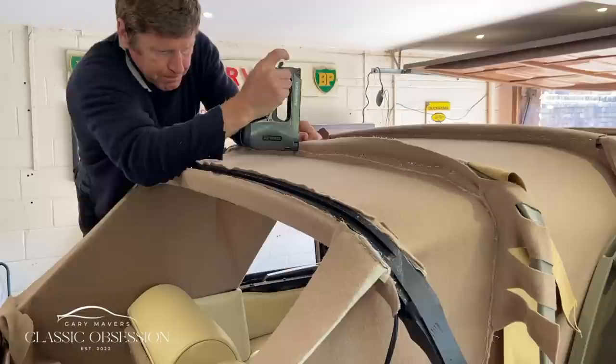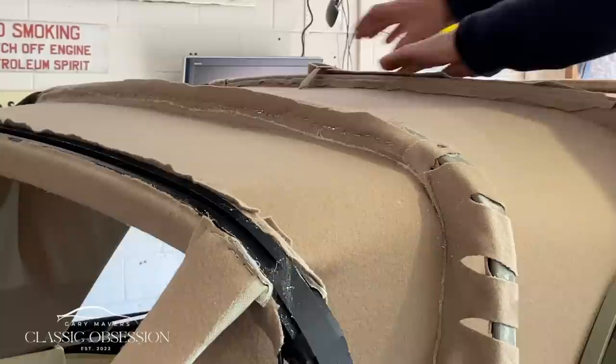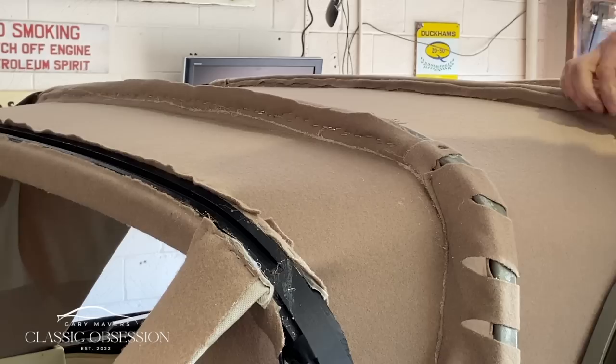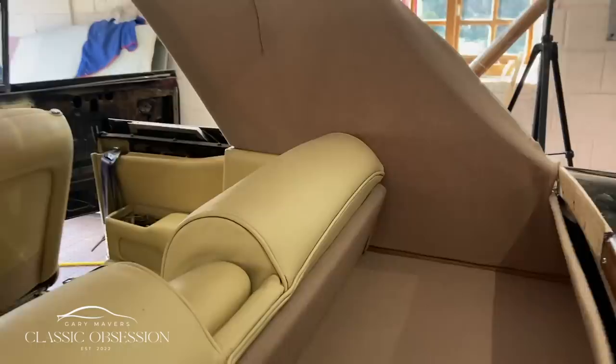So when I'm happy that my seams are straight and everything's taut with no wrinkles, I staple the headliner to the bows, into the plywood strips I fitted earlier. Then the excess material is trimmed off. I then make up a couple of thin aluminium strips and drill them through — pulling the curtain down tight, this then enables me to screw into the wooden slats that I made and fitted to the hood recess in an earlier episode. For me, this just finishes the job off nicely.